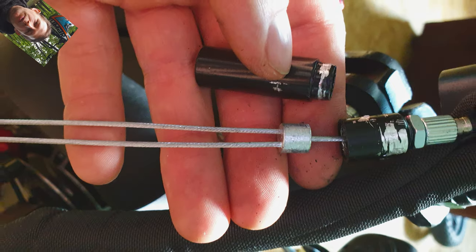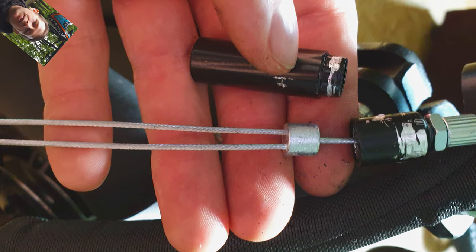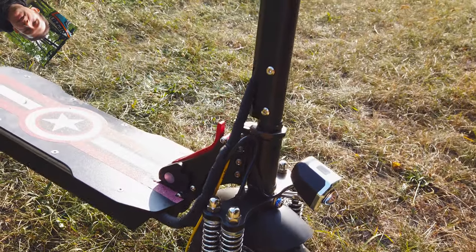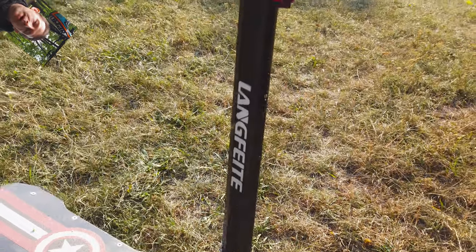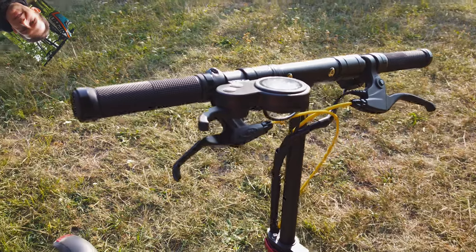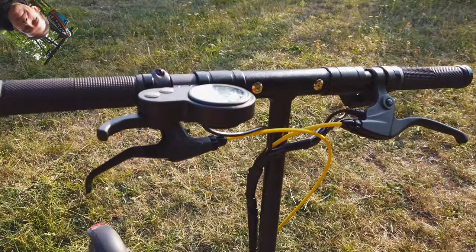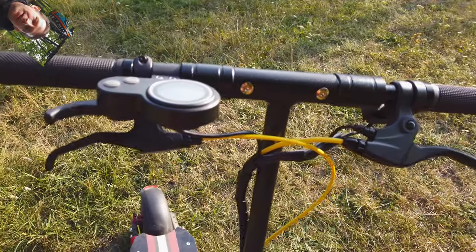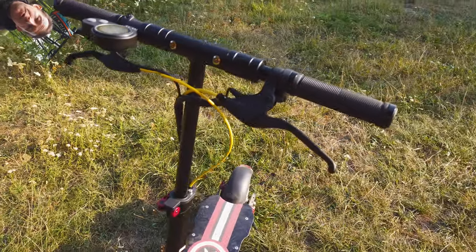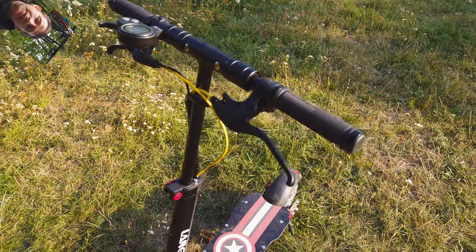It's quite hard to squeeze that lever because for one lever you've got two brakes connected. But it's quite easy to fix this issue, because the brake system is the same as on an MTB. So you can just go to an MTB shop, buy some simple wires and a right squeeze lever. You can fix it actually quite easy and cheap. As you can see in my case it looks insane. I recommend doing this mod if you've got the L8 — it's a must-have.